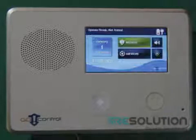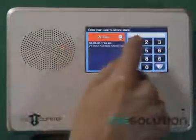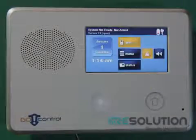To test if the sensor enrolled properly, take a wet napkin and apply it to the moisture sensor. You can also put it in the freezer for 7 minutes to test the freeze portion, and use a standard household hair dryer for 7 minutes to test the overheat portion.